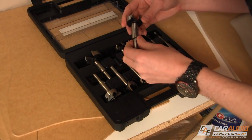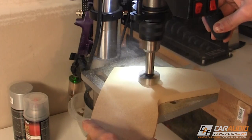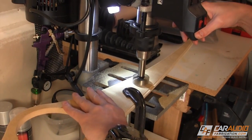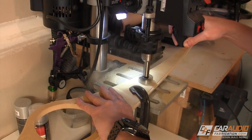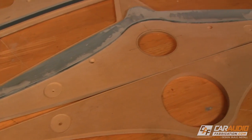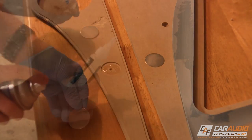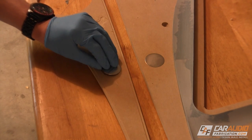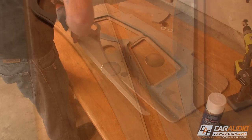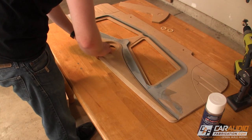The hole will also help to serve as a centering location for our Forstner bits. A Forstner bit allows me to make a very shallow hole in a workpiece. In this case my magnet is only 1/16th of an inch thick, so I'm using this Forstner bit in a drill press to make a hole of that depth. Do take note that it's probably a good idea to do this on a test piece to verify the depth before doing it on the final insert piece. I make this hole on both the false wall and the top insert piece. To secure the magnet I apply CA glue to the surface of the hole, then apply the activator to the magnet itself and press the magnet into position. Make sure that you account for the polarity of the magnets so that they attract one another and not repel. Now the top insert will simply click into place — the magnets are extremely strong and easily hold this insert in position.